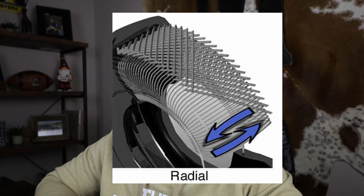That steel belt gives the tread extra strength. I'm not going to dig too much into the engineering behind radial tires, but they do have specific advantages over bias ply. The first is heat dissipation, and it's probably one of the most important reasons — getting rid of the heat built up by a tire is very important so it doesn't overheat and fail, especially on really hot summer days when the tire could be heavily loaded. A couple of other advantages: it has a softer ride, lower rolling resistance so you may get a little extra fuel economy, and better handling because the tread stays on the pavement more.